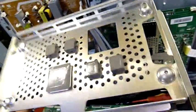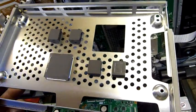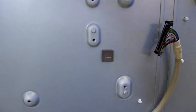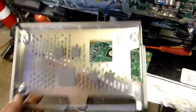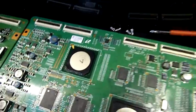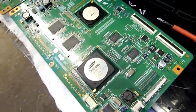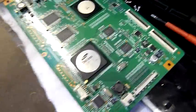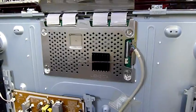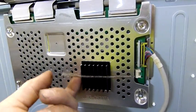They have thermal pads too — aluminium oxide in gel form with a silicone-type grease. There's one on the back for a small SMD power regulator and five on the front: one for the AMLcd chip, one marked TMU 414811, and another Samsung chip — SEMP73 Full HD. I was able to heat the heatsink up with the heat gun, twist it free, and it left a little adhesive but the whole pad stayed. So it's stuck back on and I put a spring over it for safety.